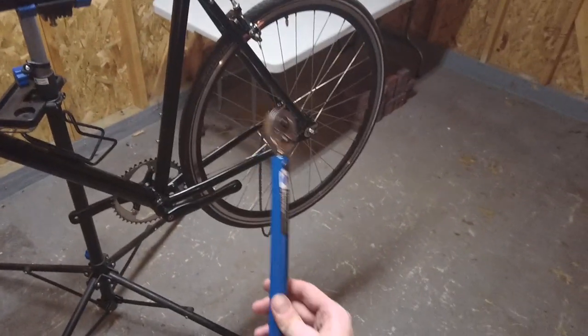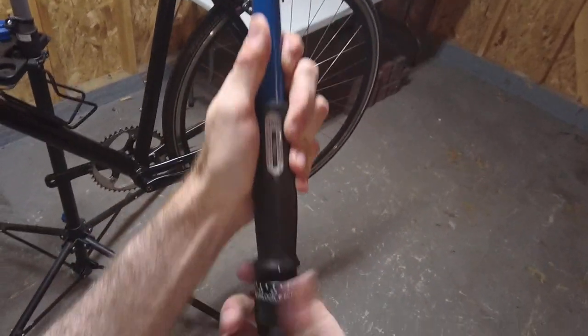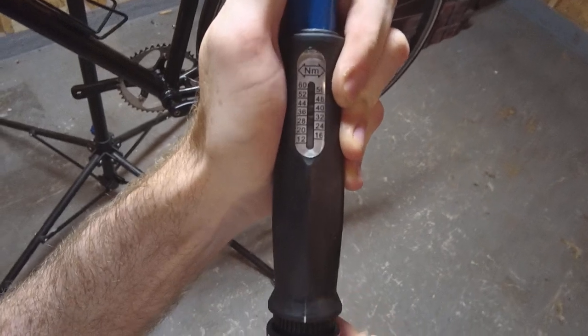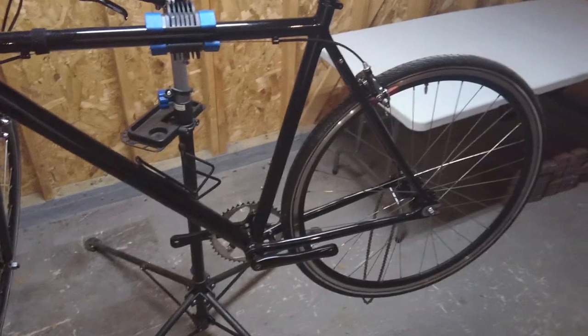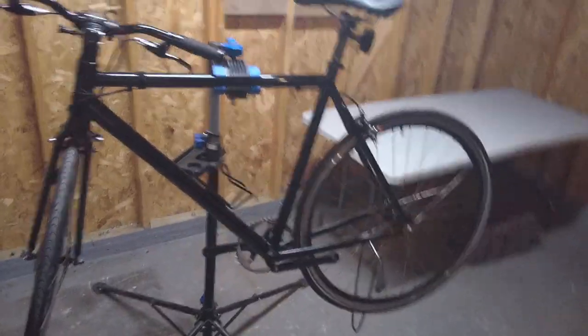Smooth. With the torque wrench, when you're done you want to bring it back down to zero — that's important. I'm going to unlock it and bring this red indicator back down to nearly zero, all the way back — so it's calibrated, bottomed out at zero. Lock it back out. That concludes how to install a square taper bottom bracket and crank. Hopefully this will fix my knocking noise problem on my bike. Link in the description below about my bicycle — thanks for watching, and we'll see you on the road. No noises, hopefully!